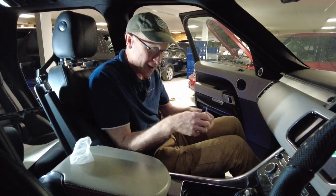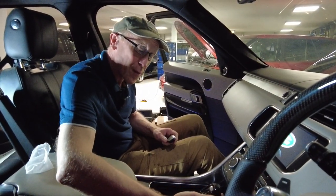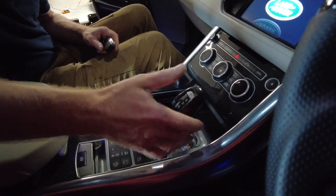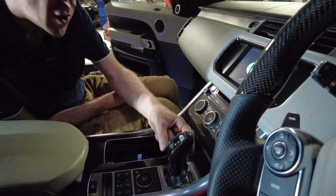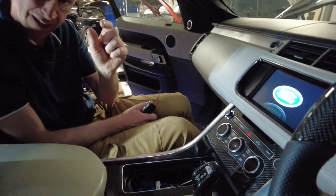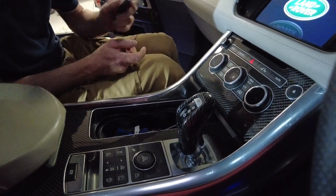In the car now. Normally you press this button and move the gear — and that's the problem. If you've got this issue, when you press the button you should hear a little click click. You probably won't hear that click if the end of the prong is broken, so that'll be your first sign you've got a problem.